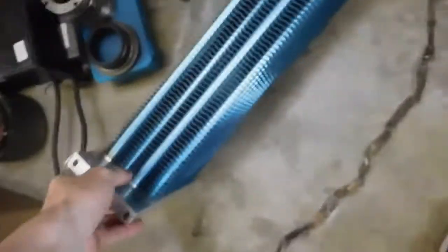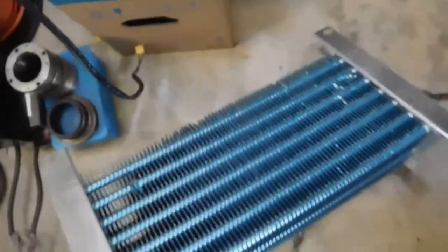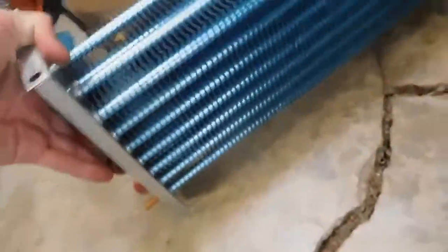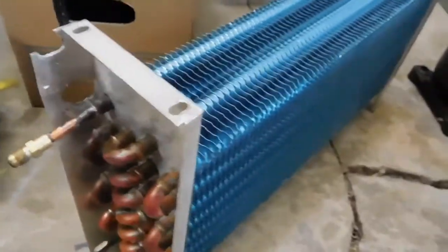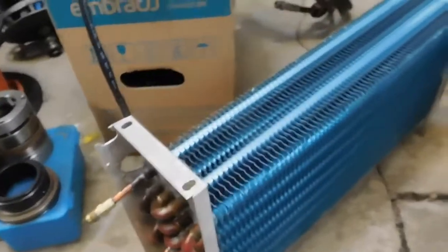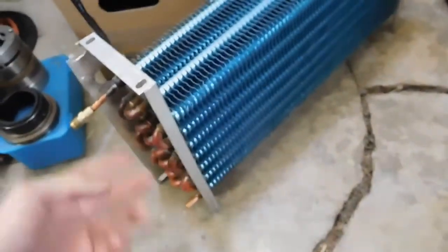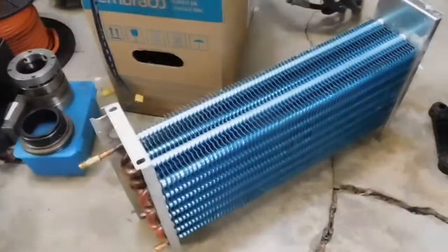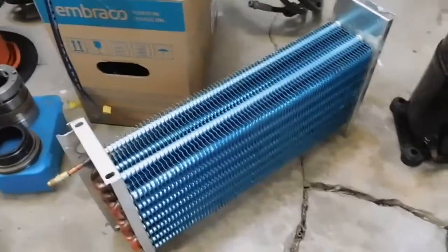And I'm going to do a pressure test of an evaporator coil. This one's got a leak in it somewhere. It's out of a Bromic branded refrigerator, commercial thing. It's probably a fine leak either in one of these U-bends or on the coil fins or something like that. So I'm going to fill it with water, pressurise it, and stick it on the pressure washer and just keep pumping water into it until something fails.